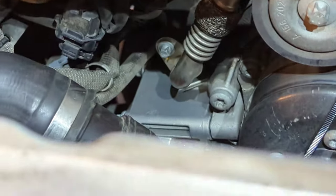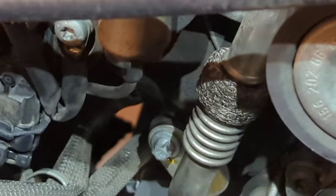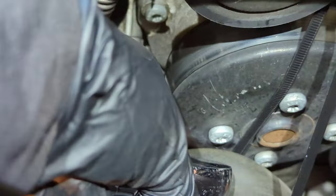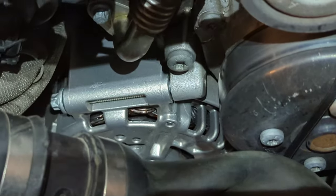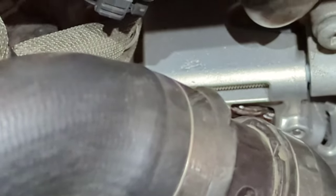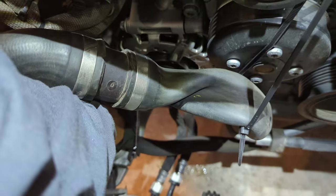I first started the one that you can see and then I tightened that one down to about 10 turns in, and then I was able to put that other one in. I got them to where there was about half a centimeter of play so that I could get the bottom two bolts in. I got the one closest to the front of the car started, then put the last one in the corner that's hardest to get to. I turned that one all the way in with my hand — it was pretty easy since it was already held on three points. I'll tighten that back corner one first, then the bottom front one second, then the top two at the end.